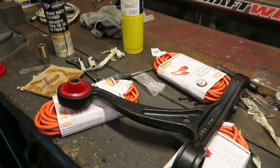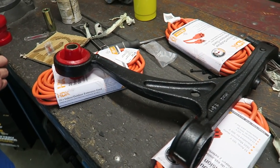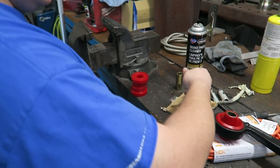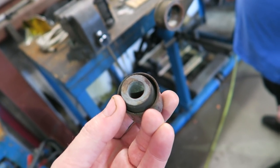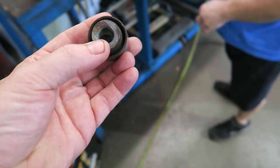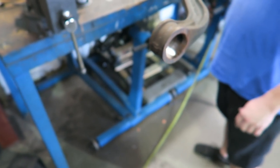George has another one going on over here. That grease is delightful, isn't it? It's worse than space grease — space grease you can see, but this stuff is like invisible space grease. This is one of the bushings that comes out — this one actually presses out. You see it's rubber. The rubber gets squashed over time. This one isn't as bad, but often you'll see it on the lower side, which means the rubber is squashed. These are a smaller bushing, so they don't get destroyed as bad. The bigger ones are the ones that usually show all the problems.